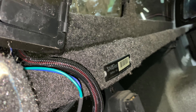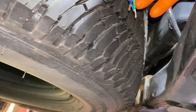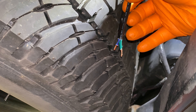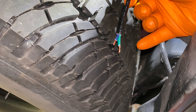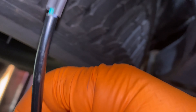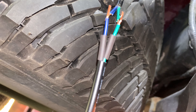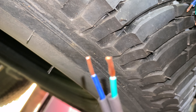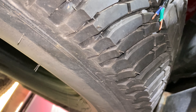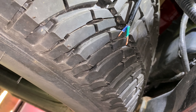The only thing left to do is solder into the existing wire for the tailgate latch actuator. Here are my two wires — already stripped and prepped for solder. The one in the back goes to the tailgate and the one in the front comes from the cab. I'm going to solder these together, and after that's done, bring the third wire in and solder it there. I'll tin these two wires first, so once they're soldered, attaching the third wire is easy — that way I don't have to strip back a whole inch of copper to twist all three together.